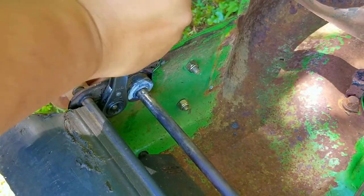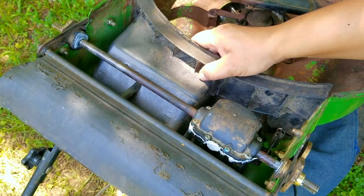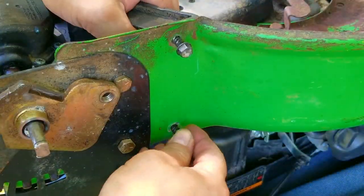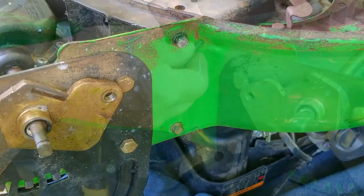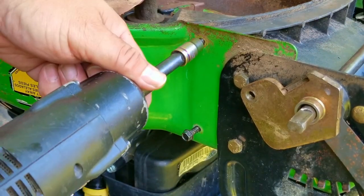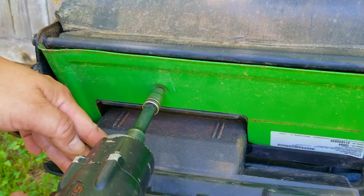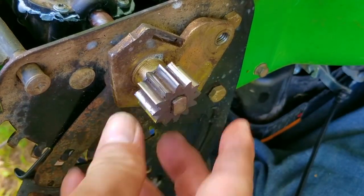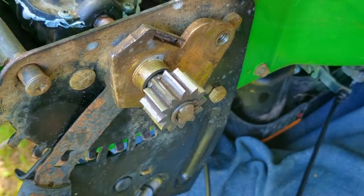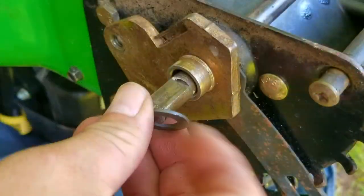Now we just have to put all the metal and plastic guards back on the mower. This mower is actually very light — the deck is very thin, and the engine is only 149 cc's overhead valve design, so it's not heavy either. That means if I wanted to I could have just removed the right side drive gear so the wheel would spin freely and we could still use the mower with only one wheel driving the self-propel. I probably should have considered that before beginning this process because it would have saved me a lot of time.